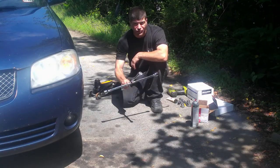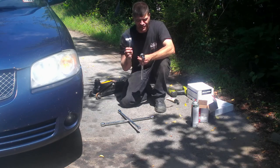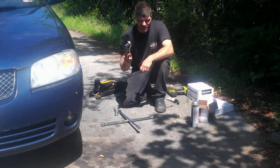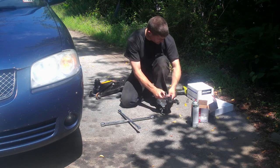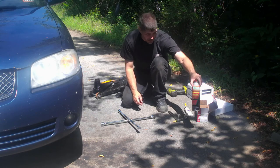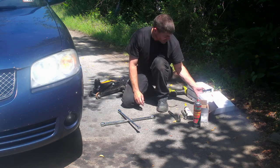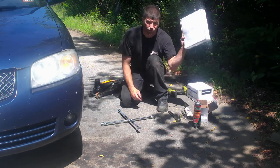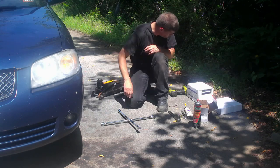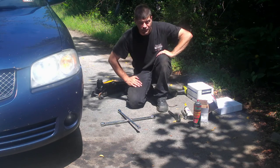What you're going to need for this is a tire iron to remove the tire, a 9/16-inch socket, and an 11/16-inch socket. You're going to have some brake lubricant, some brake cleaner, and your new brake pads. I'm doing the rotors as well, so we'll show you those — the new rotors — and a jack to lift up the car. And that's about it, so let's go ahead and get started.